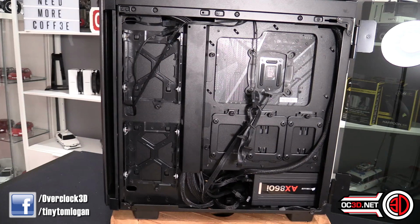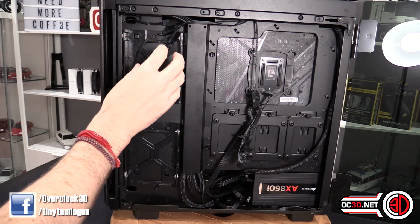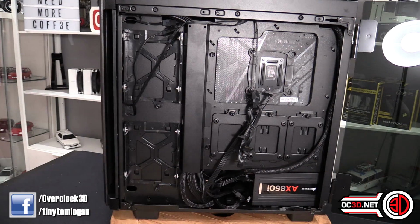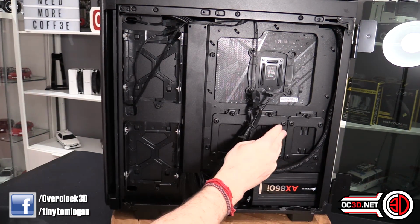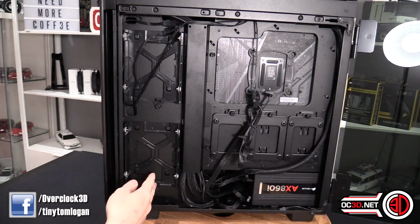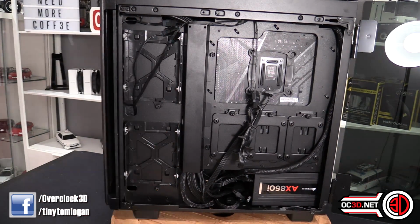Round the back section, fair amount to talk about. Again, 570X, but you can put two 3.5-inch mechanicals over here, but you have got the screw mounts in them if you wanted to put normal solid state drives in as well. You've also got removable mounts here for 3 other solid state drive mounts. So if you're just talking about solid state drives, 2.5-inch drives, there's 5 in total, although these can be used as well as for the 3.5s if you want.